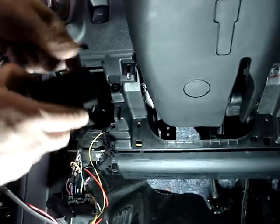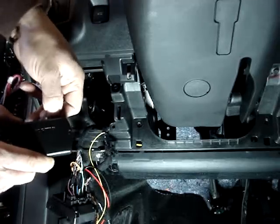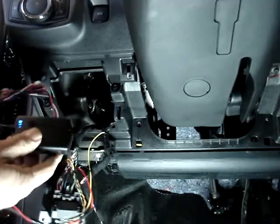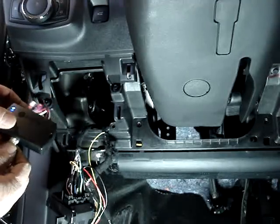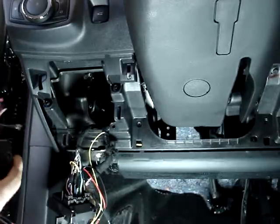So we're going to go ahead and program. We're going to hold down the program button while inserting the 4-pin plug. We're going to release when the blue light comes on. It's going to be the first one to pop on. If you miss it, you just unplug the 4-pin and do it over. We're going to plug in our CAN plug, and we're going to plug in our 20-pin plug.